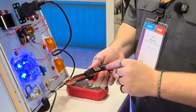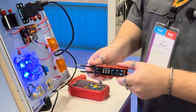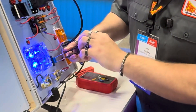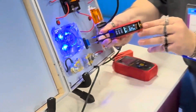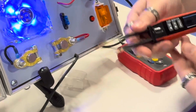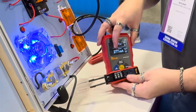So right here we're going to start at the base. We have a 15 amp ATC fuse, so we've set it to 15 amp ATC, and we are going to make contact. As we're making contact on the end right here, you can see that it has an active indicator, so we know that there's current going through this fuse — right now it's about 250 milliamps of current. So we know that we're heading in the right direction.